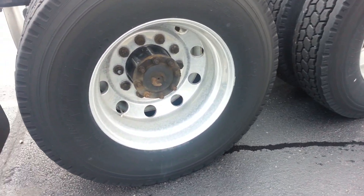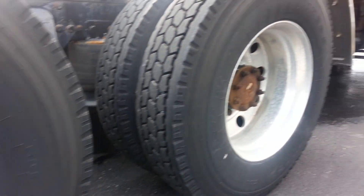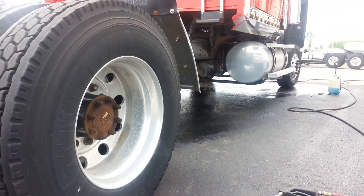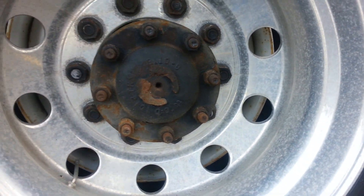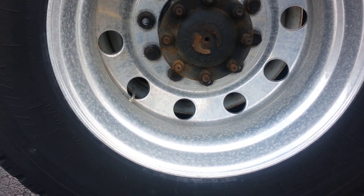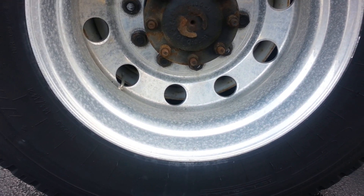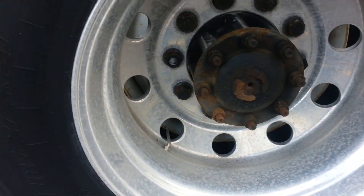What I'm going to show you today is cleaning up aluminum rims on a big truck and a fuel tank — to get rid of the nasty salt that may be on your rims left over from winter. If you do not remove it, every time we get a humid day or a rainy day, it just keeps on reactivating and eating the aluminum. So it's best to get rid of it.